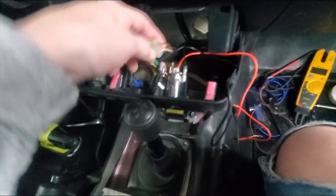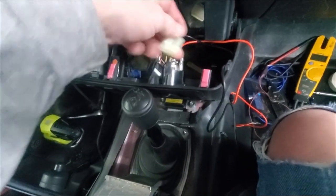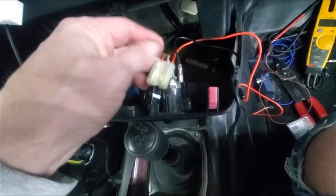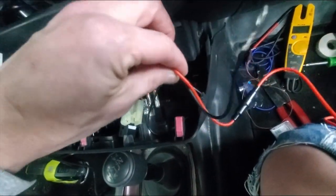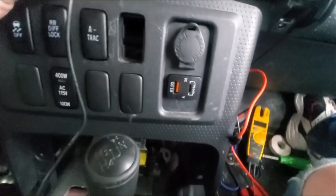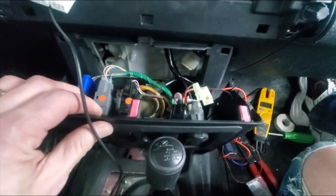In case you want to do something similar and don't want to figure out which wire is plus and minus: the one that looks kind of brown is the positive coming into your power outlet, and the one that is white with a black tracer is your negative. So the black goes to the white-and-black one, and the red — from that new plug I put in — goes to the brownish one. I think that looks cooler than the other one anyway, and the other outlet is still on its way from Amazon.